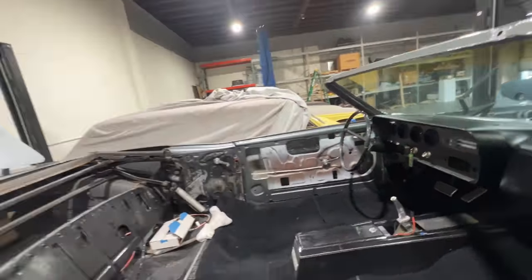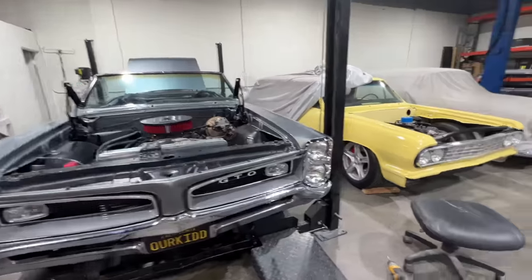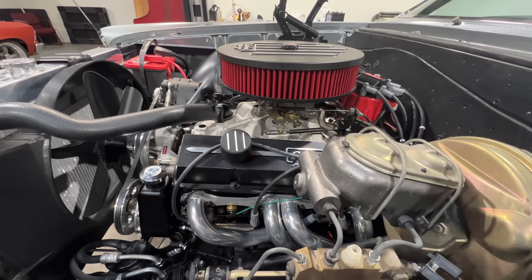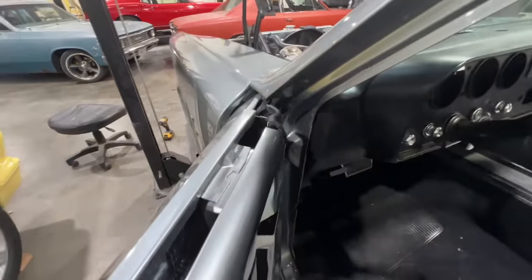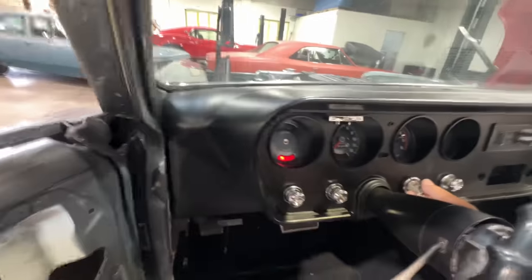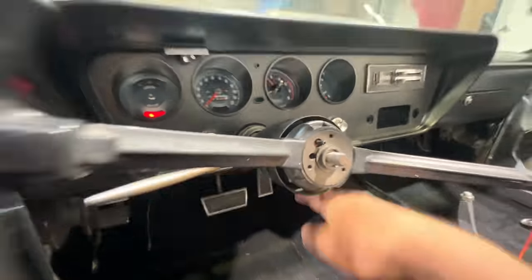My formula for a wire and fire is: you should be able to get in it, fire it up, put it in gear, and at least drive it to a trailer. It has open exhaust so it's really loud, but the charging system is buttoned up, cooling system fixed, power steering leak fixed, throttle linkage is all hooked up correctly — now has return springs, a detent cable, and a throttle cable pulling the correct geometry. Tail lights are all hooked up, blinkers and indicators are all done. I painted the dash while it was out — why not. Blinkers, all four corners outside the car work.